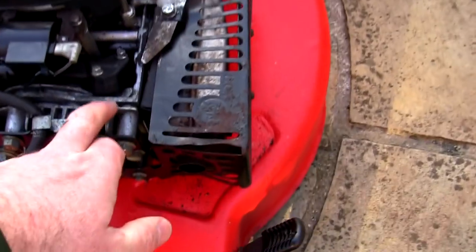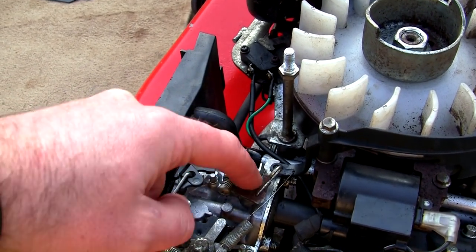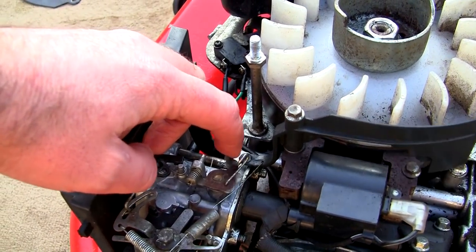So if you've checked everything else, you might just want to check out those gaskets — the inlet manifold and the head gasket — and particularly this little spring. It actually goes round on a shaft and runs around the back, and you want to make sure if you take the carburettor off that it is actually doing what it's supposed to do and that it does actually spring. I'd like to say that might be the last video filming these SV150s because I am really sick of doing these, but if I see one for 15 to 20 pounds locally it'll be tough not to pick it up. Don't forget to check out the playlist on these SV150 engines, and there's a full article on how to service the carburettor on repairlawnmowersforprofit.com. I've just hit 7,000 subscribers today, so I'm well pleased about that. Thanks for watching — please subscribe and hit the like or bell button, and post any questions in the comments section.